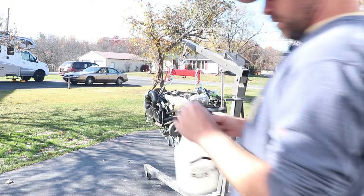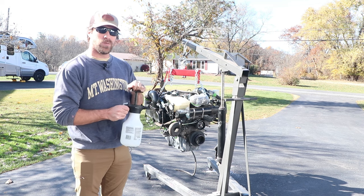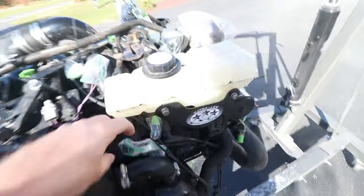Now the oil pan is sanded, cleaned up, and ready for paint, but before we do that I wanted to completely clean the engine — basically cover it in degreaser and hose it down. I actually did it two times. I'm using a pump sprayer to apply some industrial degreaser. The motor's not super greasy, but I just want something that's going to work well without a lot of mechanical agitation. I went around all of the electrical connectors and put a piece of tape over them, then a zip-lock bag and a zip tie to protect everything.